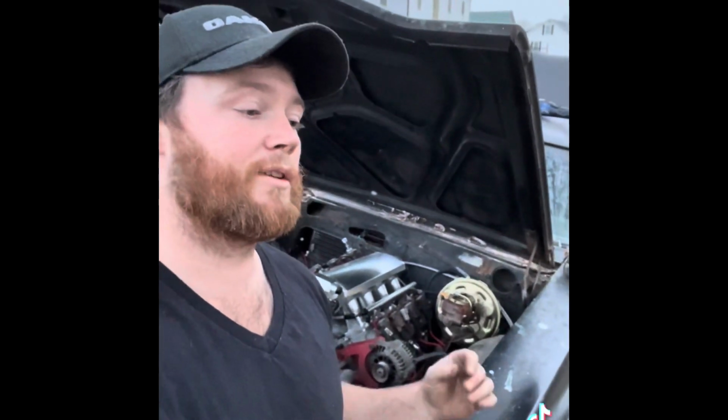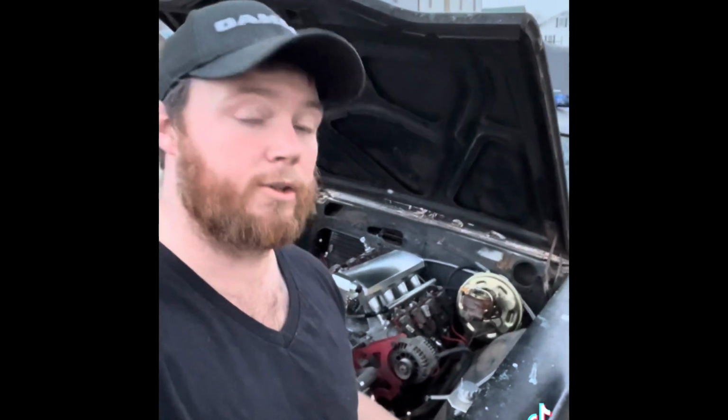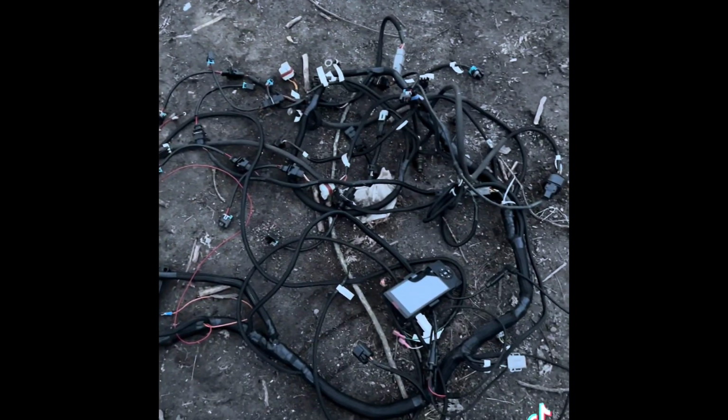Also, with the cheap harnesses, you need to make sure that you have the correct injector adapters. If you're running something like Multec injectors, they usually come with EV1, which is an LS1 style injector. There's also EV6 on some trucks, and there's adapters for all of them. The other thing is make sure that you have the correct O2 sensors for these. Sometimes they don't read, sometimes they have an issue reading, and sometimes they're just wired for the wrong O2 sensors, but just make sure you got everything and you have some basic electrical skills to be able to address what changes might be needed.